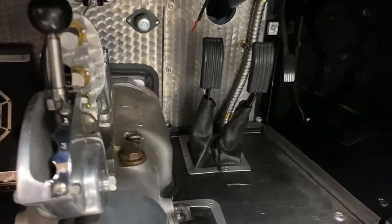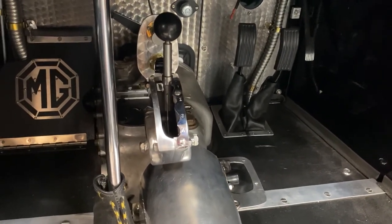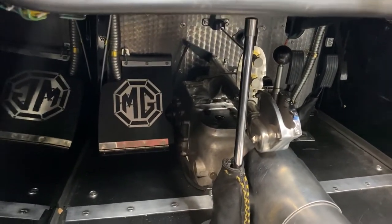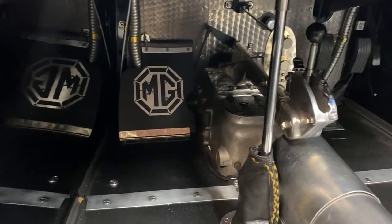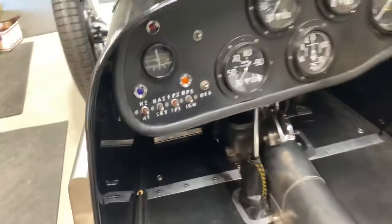There's the gear change pedal on the left, brake pedal in the center, and a little bitty throttle pedal on the right. The gear change pedal functions a lot like a manual transmission, except in the 1930s a lot of those transmissions didn't have the synchromesh to allow a smooth gear change — you'd crunch around until you found the gear. This particular box uses a series of bands and clamps around those bands to engage the gear, so you don't have to worry about synchromesh. There's our little MG logo on the passenger side footboard — one of the few creature comforts this car offers.